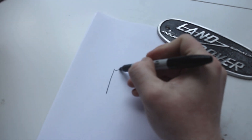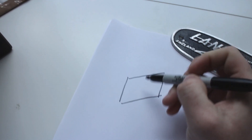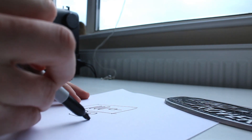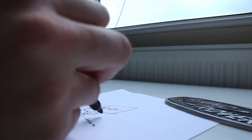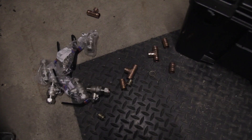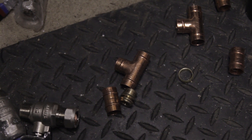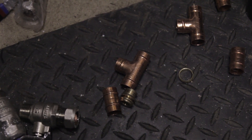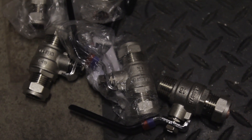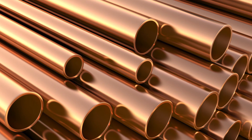Here's how we set our system up. Sketch out your spray system to suit your garage and budget — we can work out from this the length of pipe and number of connectors and valves that we'll need. We then went along to a plumber's merchants, handed them this list and picked up all the required parts. You'll need a selection of ball valves, T-pieces and straight connectors as well as several lengths of copper pipe — in this case 15mm, though you could use a larger diameter if desired.